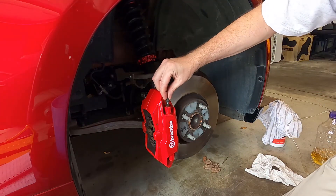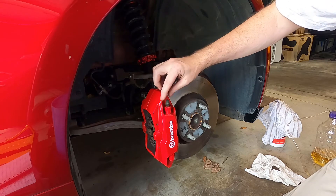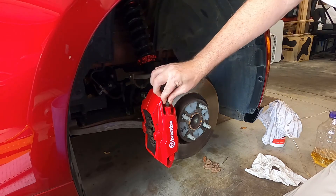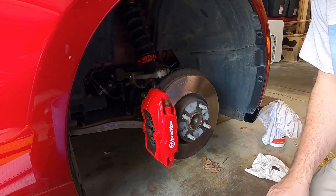Don't forget to put the rubber cap back on the bleeder. If it snaps on, great. If it's a little tight, turn it clockwise as you're pressing it down so that it doesn't loosen the fitting.